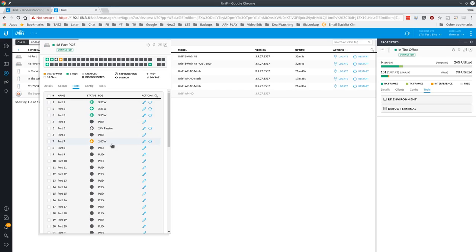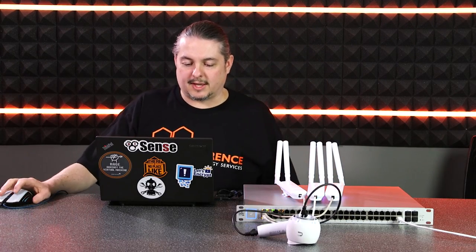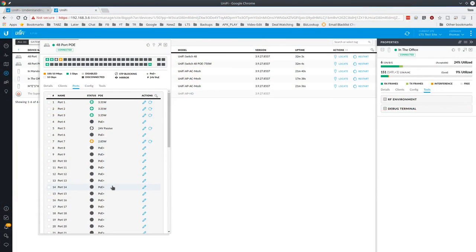The camera sitting idle is using 2.85 watts. We're going to face it straight down, which will turn on the night vision lights, and in a few seconds it will refresh and show how many watts the camera uses in night vision mode. Some UniFi devices also have options to adjust Wi-Fi signal strength, and those will affect wattage too. I'm doing all this in real time without editing, so I estimate it takes about every two minutes before the wattage display updates.